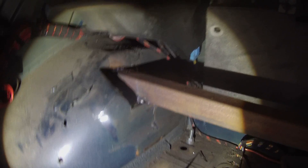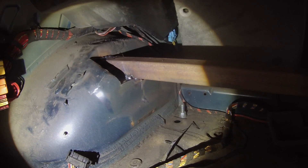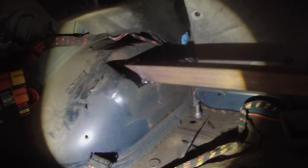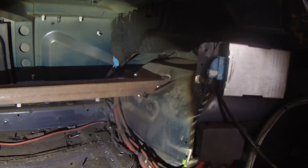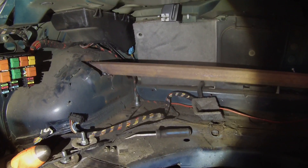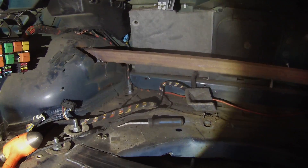Along the rails, we will be installing the interior subframe, and that will then be welded down to the strut brace. Basically, the weight of the car will be carried by the subframe and not just by the body sheet metal that you can currently see here. That's where we're at at the minute — we've got this in and we're going to go ahead now and work up the interior subframe.